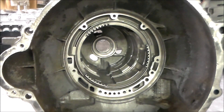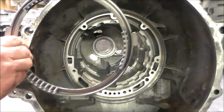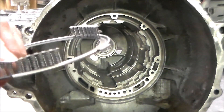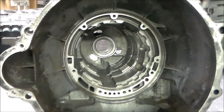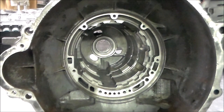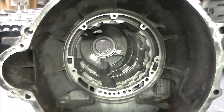I just wanted to do a quick tip video so you can see where the springs sit, so you can install the piston correctly and the check ball does not interfere with any of these return springs. For 4R70W series transmissions, basically 2004 and up takes the molded piston. There are different variations — there are these springs, there's one you don't have to worry about, and then there's another one that has just a little notch for the check ball to go into, so you'll have to line that up real good. Thank you guys for watching, have a great day, and we'll see you next time.